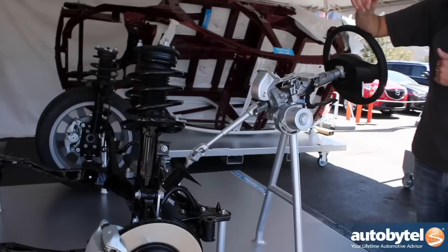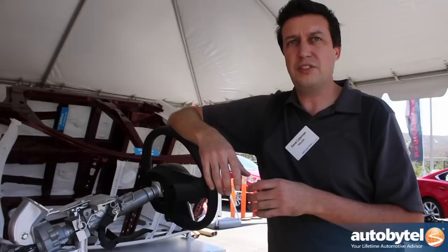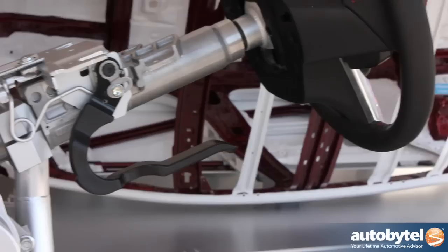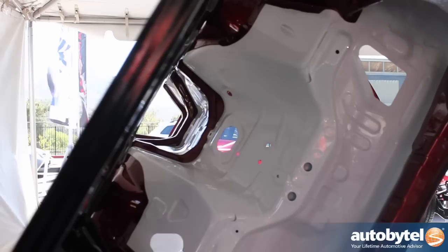So what we did is we built in a lot more caster angle in the front suspension. You can see that the strut angle here is kind of leaned back. In the old Mazda 3 it was leaned back about three degrees, which is typical for a front-drive car. A rear-drive car will typically be around five or six degrees — the RX-8, for example, was six and a half degrees. This car is also six and a half degrees, which is pretty much unheard of for a front-wheel-drive car. With hydraulic steering it would be really hard to get the steering effort right — it would usually be too heavy, or if assisted enough to deal with the high forces that caster angle gives, it would be too numb the rest of the time. But with electric steering we have the flexibility to really build in some good steering feedback.